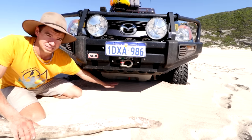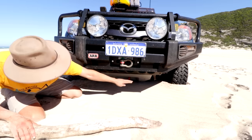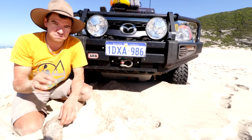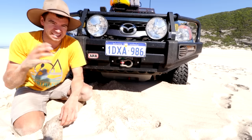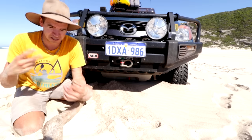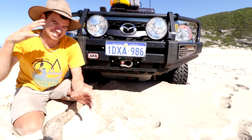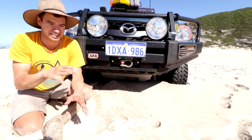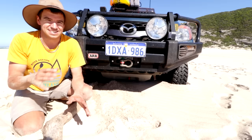Under there you can see it's bottomed out on the bash plate. At the front I'm going to get it away from the suspension arms, then go around the side and reach in from there. One important thing: you may be tempted to try getting out sooner rather than later, but you're generally better off waiting. If you dig a little bit and then try to go, if you start spinning wheels you're just going to dig yourself further in. You're best off holding off until the car is completely suspended just on its wheels, not on the sand anywhere under the car.